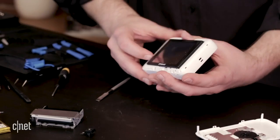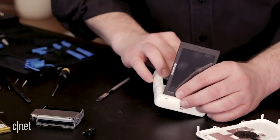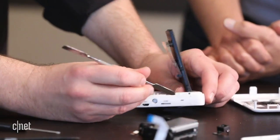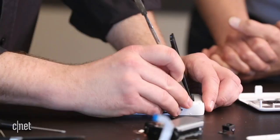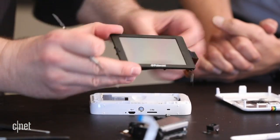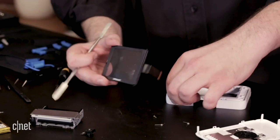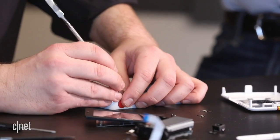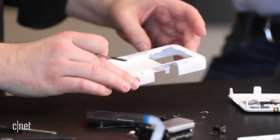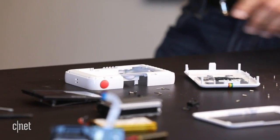The last thing to remove — if this is the LCD screen right here, we can see the last cable here. It actually has just two little pins on the side that just pull out — they're not screws or anything. You pull one of them out and you can separate the LCD from the plastic body. There are a couple of springs that fall out that hold it and help it pop up, and the other pin is on the other side — they're just pressure fit with a little bit of adhesive to hold them in place. And there you go, that's all there is to it. It was a really fun teardown because it was really interesting to see how you can marry a digital printer to a camera, put it all together in one package and create a fun little device.